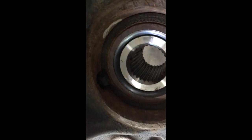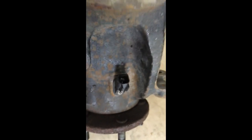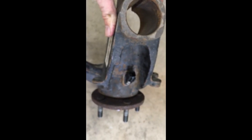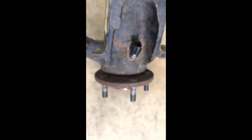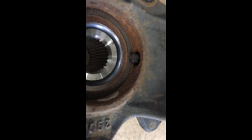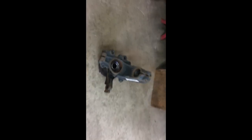There's your ABS sensor. I left it in, but it's pretty smart to just take it out right away, because all the banging is probably not good for it — lots of hammering and whatnot. There it is — Torx 25. Pull it out. Mine is kind of stuck in there good, so I'm going to try not to damage it. Don't want to buy another one.